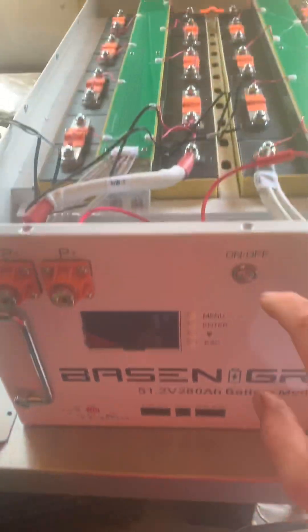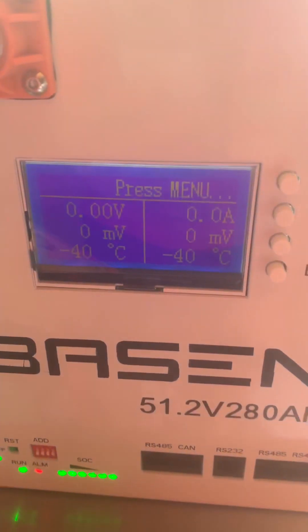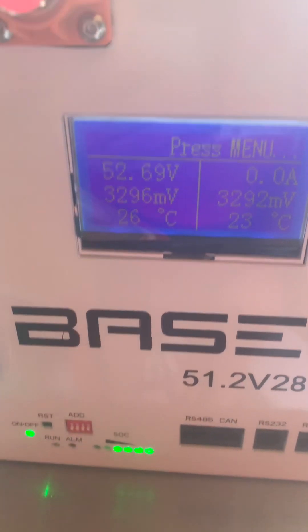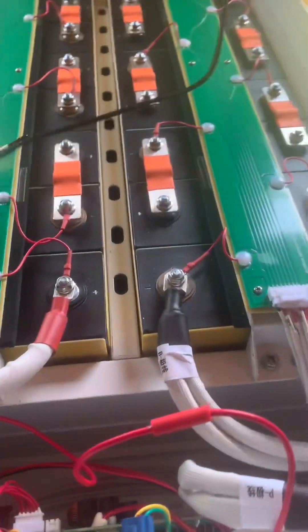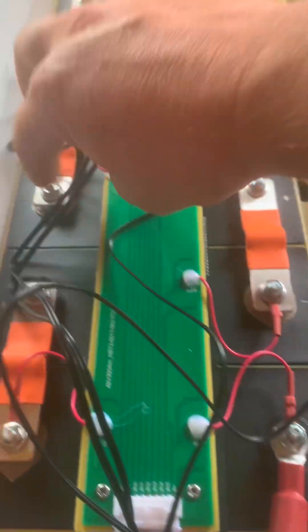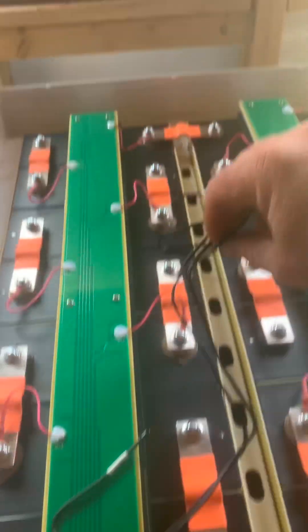I'm guessing you've got this wire here — the main positive — you put them together at the end and turn the actual battery on. All done, all torqued. Right, turn it on and see if it works — there we go, it comes on! Also in here there are four temperature leads. You get some heat-proof tape, put them on the cells — I normally have mine on the terminals, positive and negative, and I'll probably poke one down in the bottom and put one at the back.